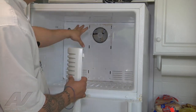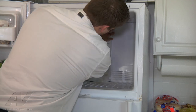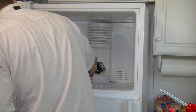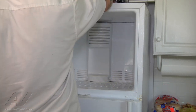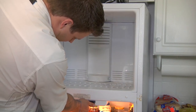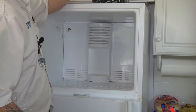So now our next step is to reposition our fan motor cover. Before we get that in place, slide it down like that, and then put in our two screws. Now before I get too far, I'm going to go ahead and turn the refrigerator back on and make sure I don't need to make any adjustments by the fan motor. Alright, so the fan's on — everything's good in that aspect.